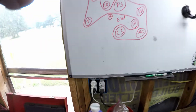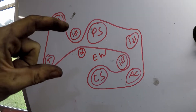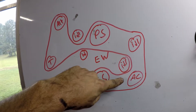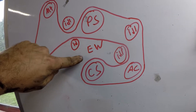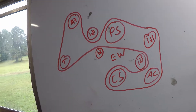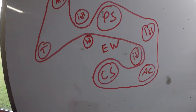Now that we've got that all talked about, here is a diagram for you — go ahead and take a screenshot of that. You can see here: alternator, idler, power steering, idler, AC, crankshaft, idler or whatever that big one is, electric water pump which obviously has no pulley, another idler, and tensioner. There is your diagram that I could not find anywhere on the internet. I spent a whole hour on Google and YouTube trying to find this and couldn't find it anywhere, so you found it here first. Thanks for watching — see y'all next time, don't forget to like, subscribe, and comment.